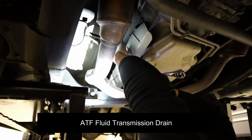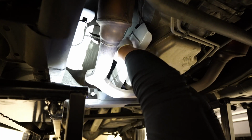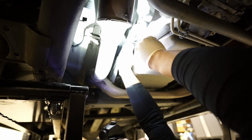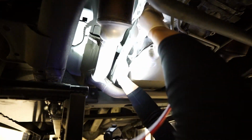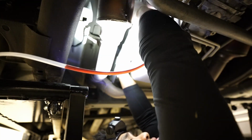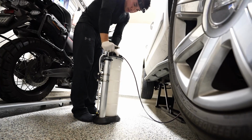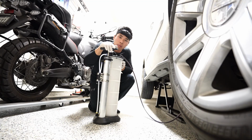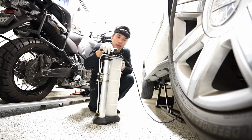This is a 2017 Cadillac Escalade, by the way, with the 8-speed transmission. The transmission fluid evacuation is usually a 12 to 24 hour process, so I'm just gonna let it evacuate and I'll come back tomorrow morning. Drop the pan, take the filter out, put everything back together, fill the pan back up, and then move on to the front differential, then the transfer case in the rear.